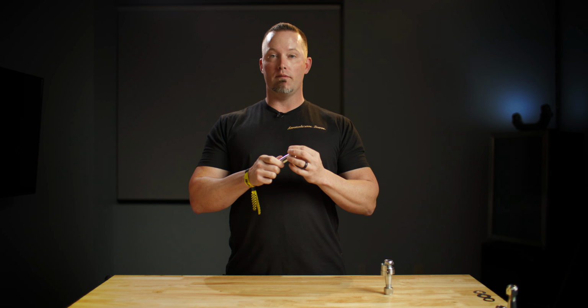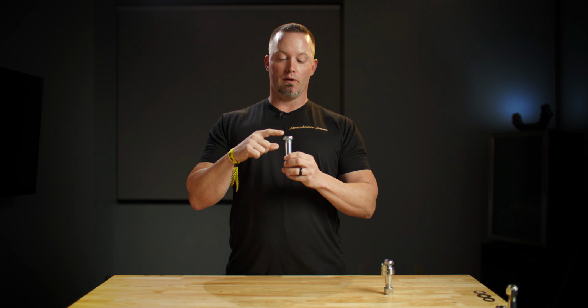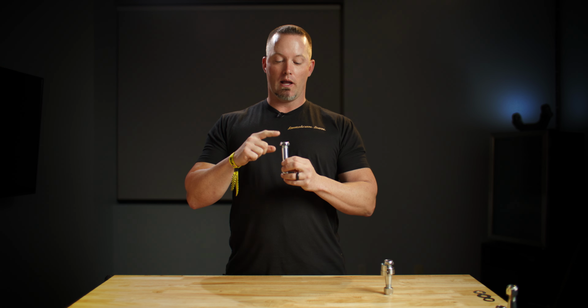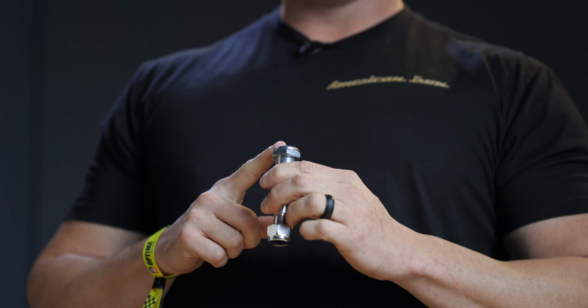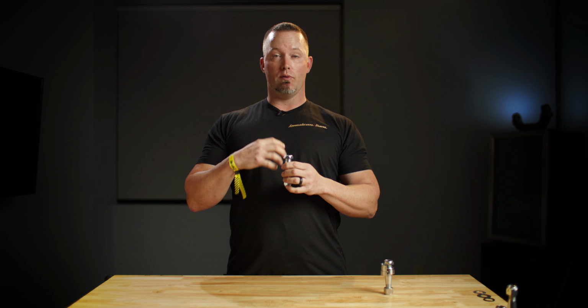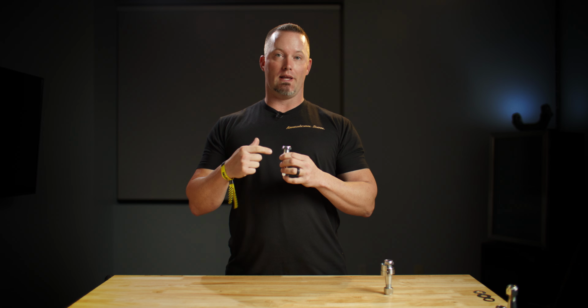The other benefit of that is after you assemble, you can actually control the steering firmness through the adjustable axial load feature that the ball joint delete systems have by this one single nut on the very top ball joint. By doing the steering firmness adjustment design, you can actually help stabilize that joint like we talked about earlier, stability versus mobility. And so you can actually help stabilize that joint 5 foot-pounds at a time to control steering firmness. And what that does is it applies axial load to the spherical bearing in the top, and you can help eliminate some of your wandering and death wobble even in that aspect.